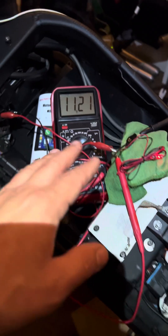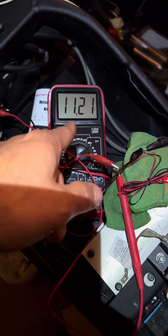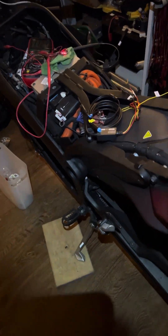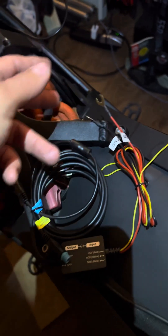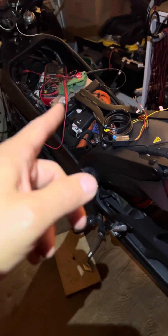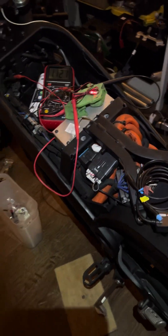I can always change it at a future date, and I'll use this video as a reference for this test. If I really want the parking-sensor feature — where when the motorcycle's powered off, if it's bumped or there's an impact, it records for a certain number of seconds — then I'll need to revisit whether 11.21 volts is enough for that continuous wire. I don't know if the recording duration is fixed or adjustable yet; I'll learn that as time progresses. Okay everyone, that was just a quick update video. We'll see you in the next one. Bye.